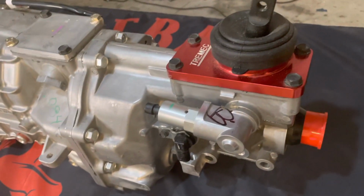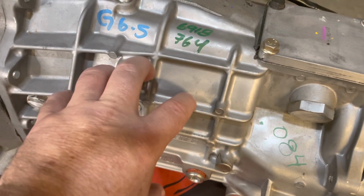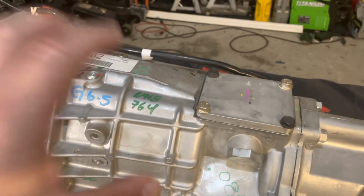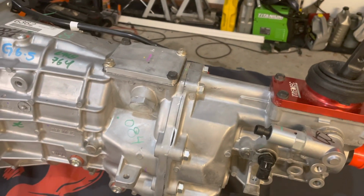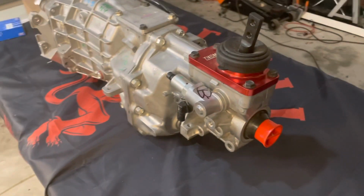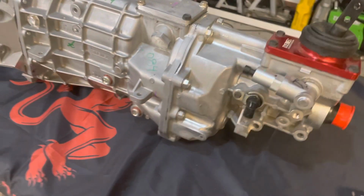So that's the TR6060. Now what Tremec did was they took all the internals, right? Everything that's in here inside a TR6060 and put it into here, right? Bigger gears and better mesh synchronizers, beefier input shaft and the more spline output shaft. And so they just beat the hell out of it and made an amazing transmission. So the Magnum was almost the staple of all the pro touring guys, the guys that are upgrading their cars, right? With the 6-speed. So that was the Magnum.